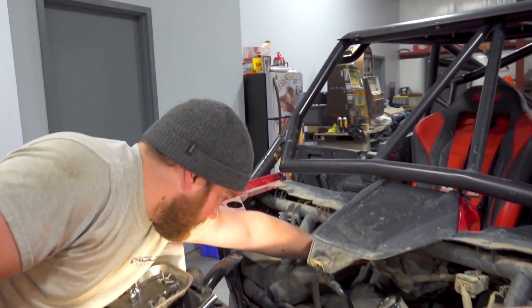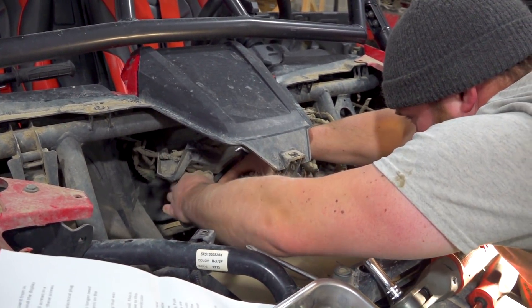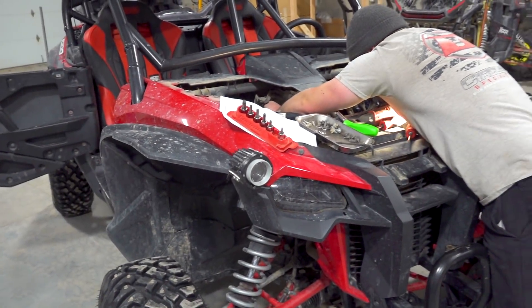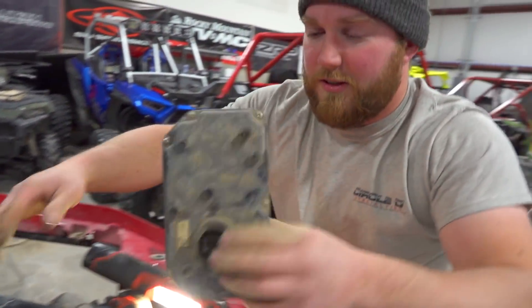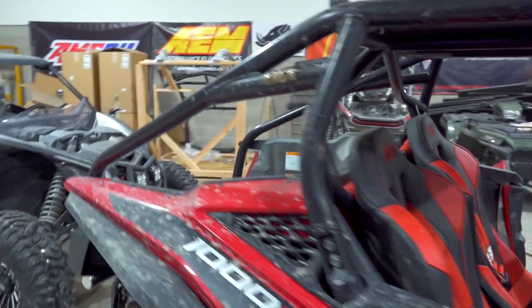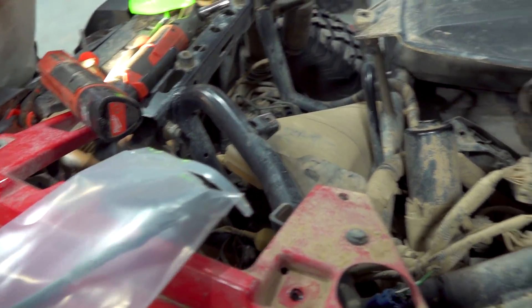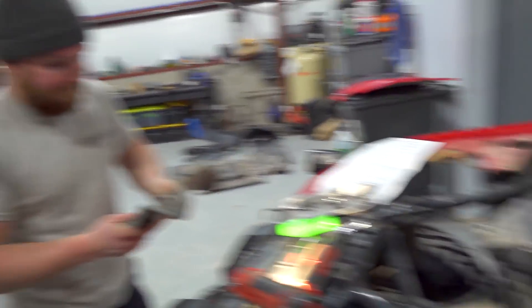Three bolts are out. Is that dash going to come out for us now? A lot of dirt in there. This thing's been treated with the utmost respect and care — it's the toughest machine available, I'll say it. I've done some dumb things and it's held up just fine. There's your little cluster. There's the plug, and then we have this extension harness that will allow us to route it up to the steering column. Really nice piece, all terminated well. We'll get this thing unpackaged and move on to routing that over to the steering column.